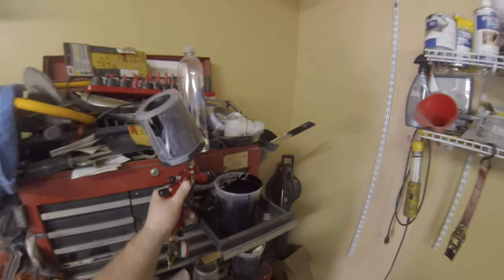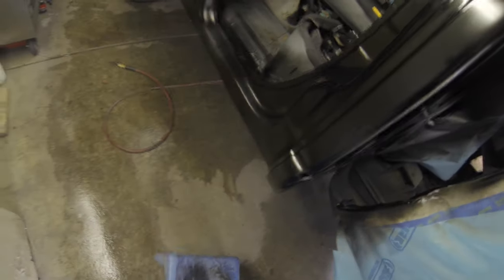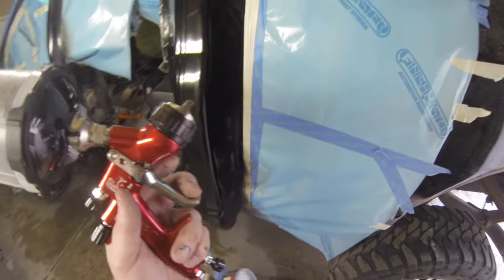I've got the first coat down. I'm just checking to make sure there are no bare areas — want to make sure I got a solid coat over everything. Going around to the other side — I already had one coat on this side. I can tell there's not a lot of paint left in the gun, so we're going to refill it. Got it refilled — I never fill it all the way up, about three quarters of the way. And you better wipe off that hose before you get up on the truck, because that hose can get wet from laying on the floor and the next thing you know, you drip some water on the paint. And that stinks.